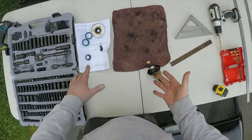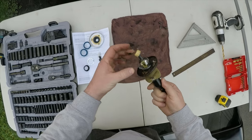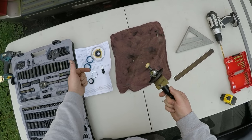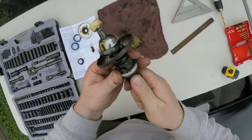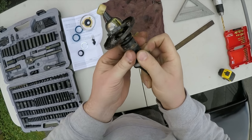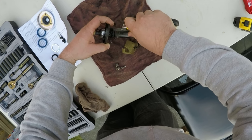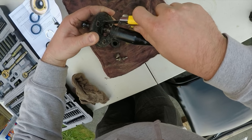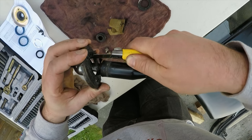With the transmission rebuild kit, we have a replacement top hat seal — this one is completely torn — plus a replacement bushing and spring plate for the top, and a replacement bushing for the bottom that goes inside the transmission end. First, remove the foam insulator — this one's pretty ripped and torn. The floor plate seat is held on with a zip tie; cut it free. Then cut the remaining top hat bushing off the seal portion, and cut around the upper plate to remove all the rubber seal, so it can slide over the transmission shifter shaft. Cut as close to the metal as you can.